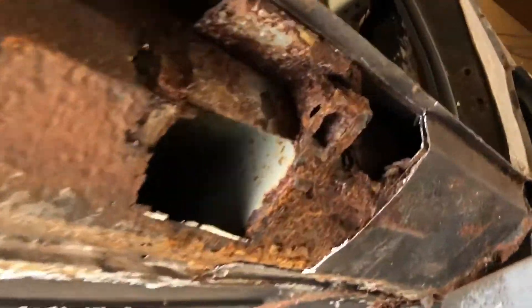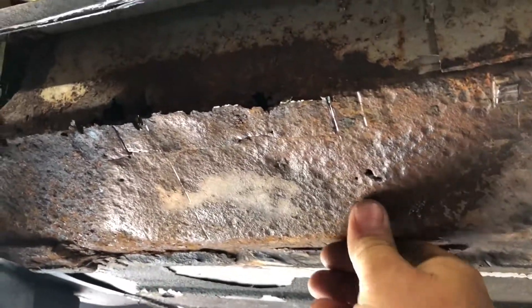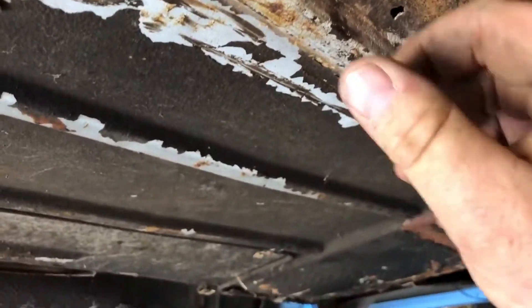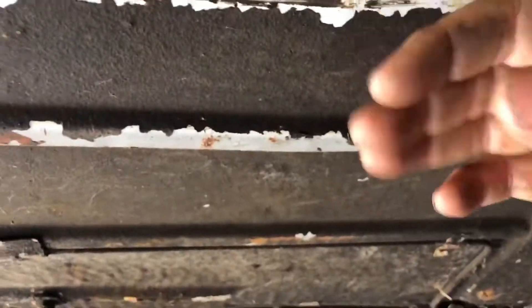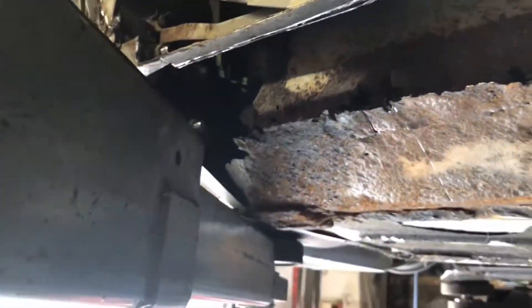That's as much as I've done - I haven't cut that little bit off yet, but I've started cleaning this up. As you can see it's really pitted and very thin in places, so no doubt I'll end up putting some new metal in there because it certainly needs it. Just looking under here as well - a few little holes, but from this point inwards it all seems absolutely perfect, well not the front here obviously, but the actual main floor section. You can see where this cover seal was tacked - a little tack there, a little tack there, tiny little one there. Literally just hanging on - how did that get away with an MOT? It's incredible.